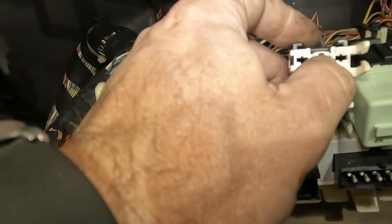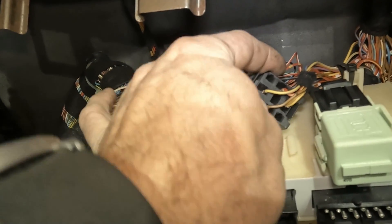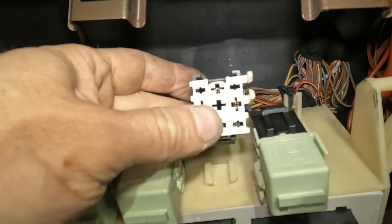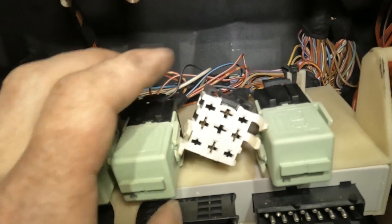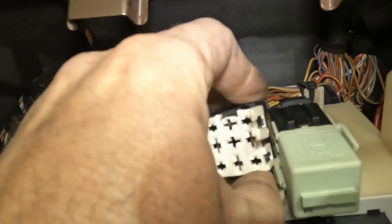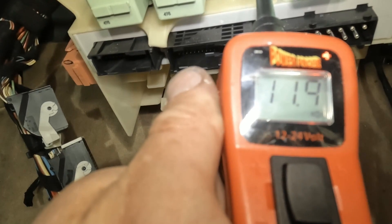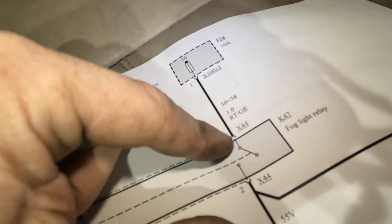Looking at this from the front, pin 6 is the pin that should have power. We can flip this to the backside, which should be easier, and verify with our wire colors what pin is the right one. We can check for power and signal right back here. Going to the relay holder is really where you want to go to figure out this problem — it's a great way to divide and conquer. The first thing to check: are we getting power from fuse 38 to the relay? That is pin 6, a red and yellow wire. We take our power probe — and it should beep for 12 volts. That is good. We are getting power to our relay.